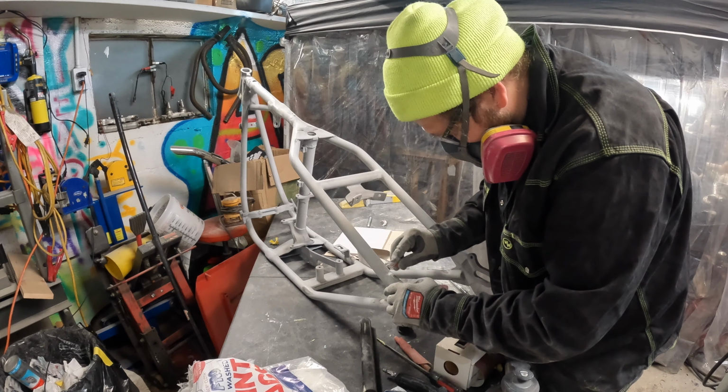All right, so here we are. I ended up doing some work off camera, basically a second round of high build primer and sanding, and using a little bit of glazing putty to fill in some areas that I could just easily see. I didn't think it was worth filming. It just seemed redundant and not worth the time. So that was taken care of. Just got this done in a sealer. The high build primer that I have is also a sealer when you reduce it. So I followed the instructions, reduced it down, and it sprayed out really nice.